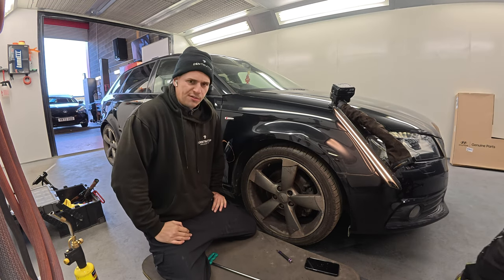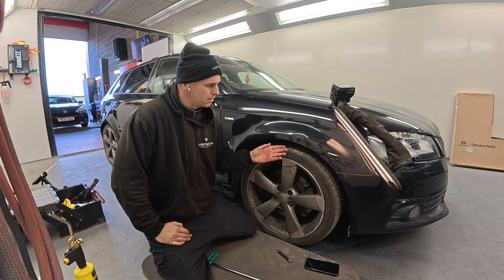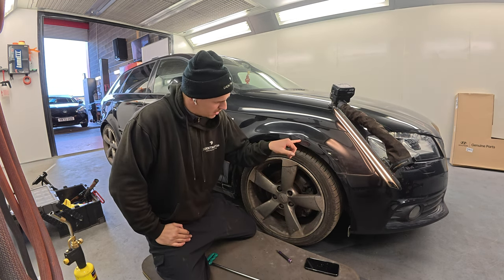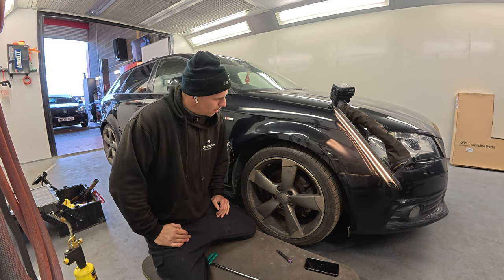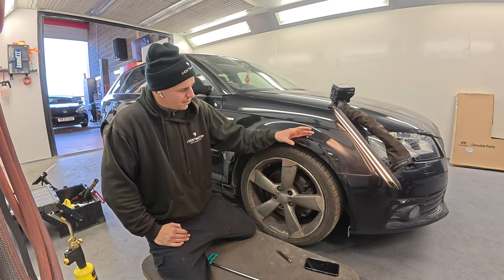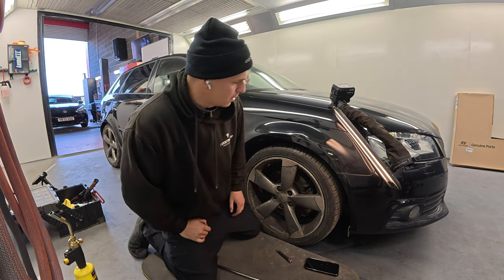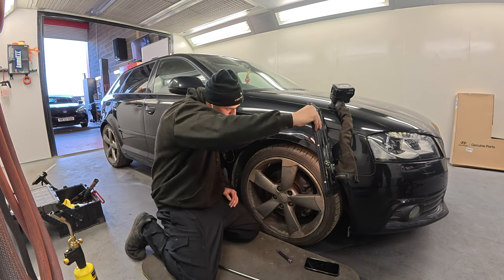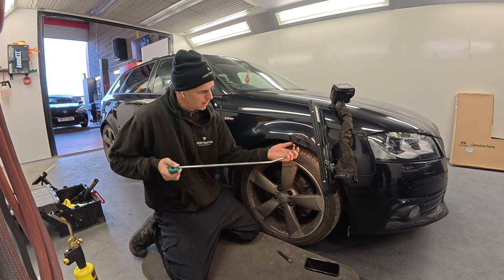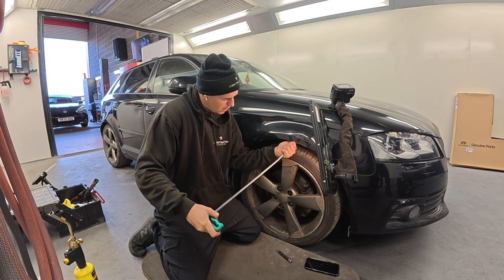that's all back roughly where it should be. Now you can actually focus on freeing that metal up because it knows roughly where it is. There's a bit of a high there, but the line has started to come back to where it should be roughly. Once you start moving that metal, that'll free everything up. And you could actually polish it a bit more now, which I won't do in a minute, but I'll just push a bit more of this metal up and then I can start getting onto a bit of tapping and actually start to blend that metal back to the right shape.